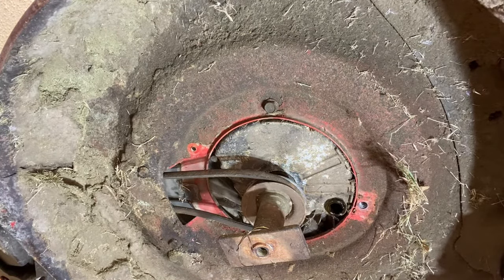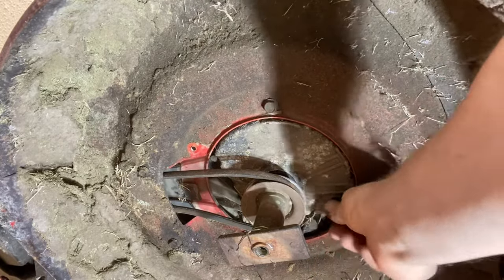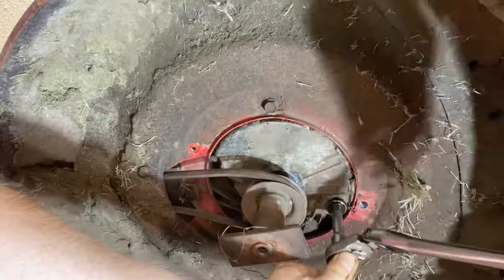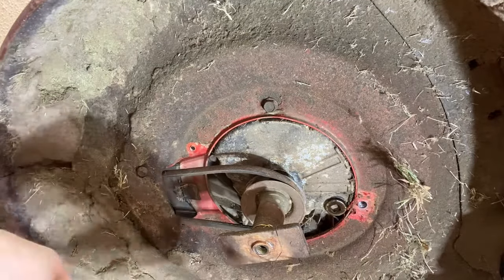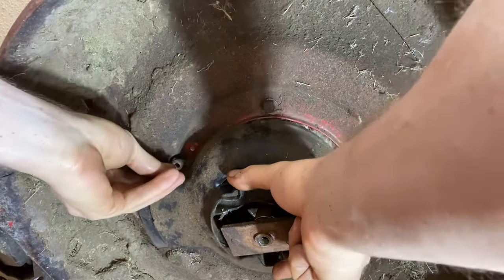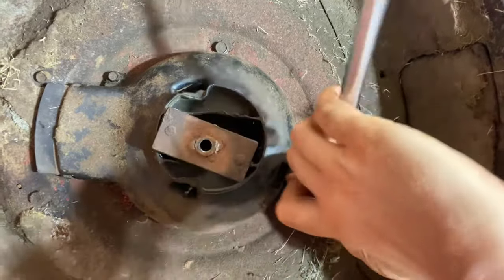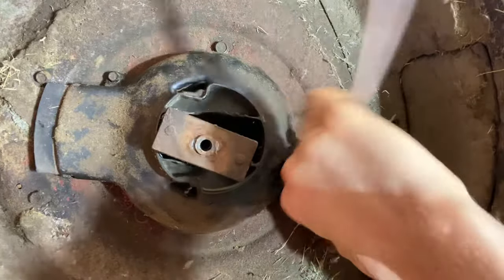We've let all that nasty old oil drain out. Screw that drain plug back in — make sure to clean it before you put it back in so you're starting fresh. Tighten her up, but you don't want to put He-Man strength on it. Make sure she's tight so you don't have a leak. These are aluminum cases, so don't go super tight — I usually put about 10 pounds. Slide your little cover back up, line her up, and put your bolts back in. Put your 3/8 on there, then the half-inch. When you put this on, make sure it's tight because it's actually holding the motor down to the frame of the mower.